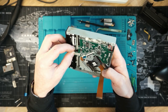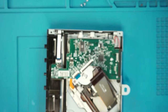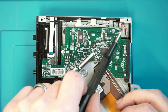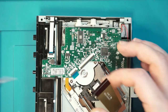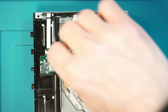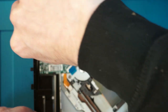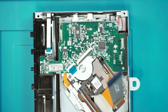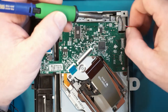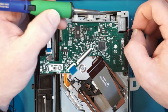I can't see anything wrong on this board. I appreciate I said no soldering or very minimal soldering, but I'm going to release these two cables — you don't necessarily have to. There's one screw, two screw, and three screw here. When you've released the ribbon cables you can fold the board back. Since I've got the soldering iron, it just makes more sense to me — just give them a touch and pull the cables away. Just rest your iron on there and they will come.